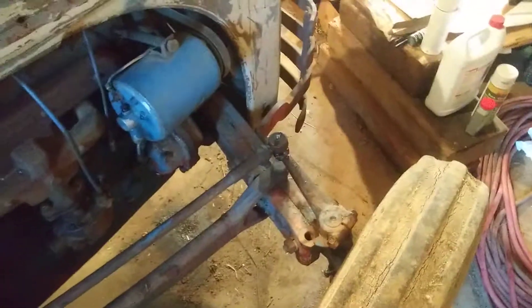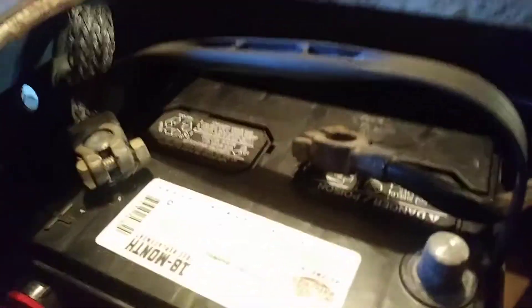Under the hood we've got a 12 volt battery now. This is still meant to have 6 volt — it's got the generator on there still — but it must have gotten cranked up by the previous owner because it's charging 12 volts. I'm not 100% sure about that.